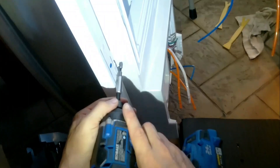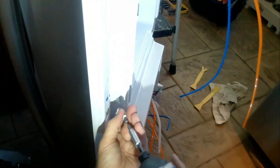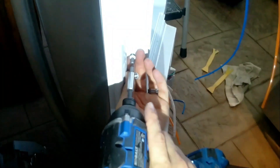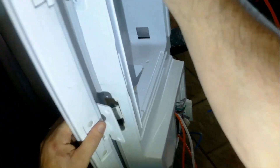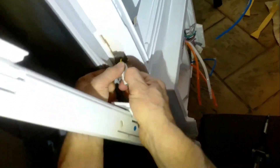Let's disconnect this door heater — it's pretty simple. There are two Phillips screws and there'll be one harness behind it. Once you remove these two screws, you'll lift up on this heater assembly — the door heater. It has two latches — go straight up and disconnect the harness. This heater is to keep moisture or condensation out of the fresh food section.